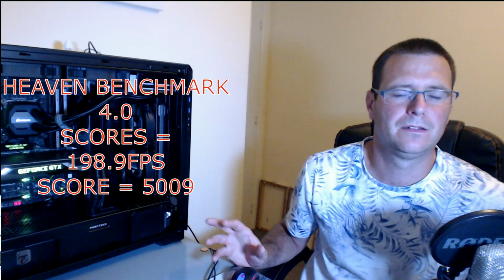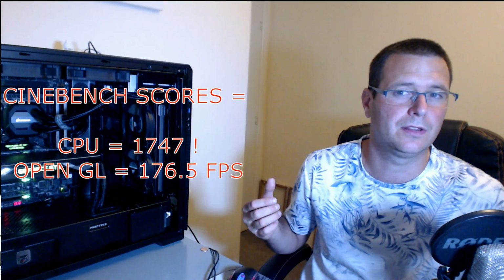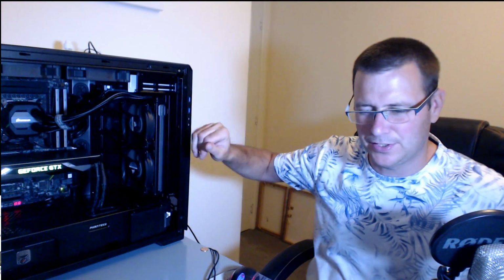I may try and push it just to 4 gigahertz. There's a gaming overclocking preset inside the BIOS. Yeah, I've tried to do that already, but it just froze on me. I had to reset it by jumping the pins, to reset the BIOS. It might be something to do with the voltage, but yeah, I will try and boost it to 4 gigahertz, and then I will do some Cinebench scores and put it in the description for you, see what I can get out of it. I did one earlier, the OpenGL was 136 or something like that. I can't remember what the CPU score was, but I will put the benchmarks from Cinebench.